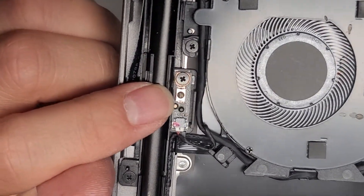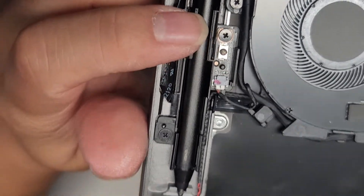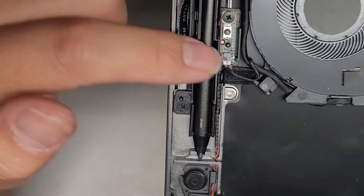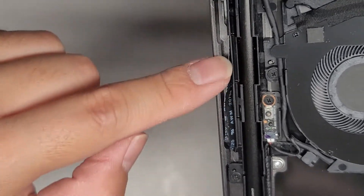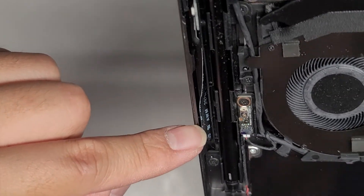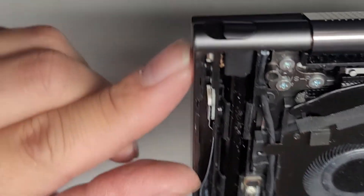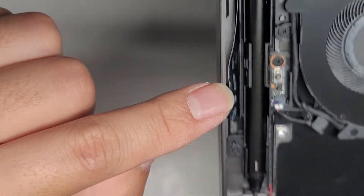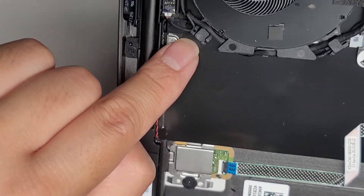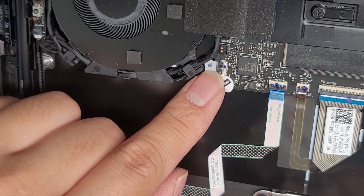Here's a closer look at the battery reset button that you can access from the bottom cover. There's the digitizer or stylus here, with a connector going in there. That's actually the power button cable — so the power button is here. The cable runs along down here, flips over, goes underneath the fan, and connects right there. So if this is messed up, the power button won't work.